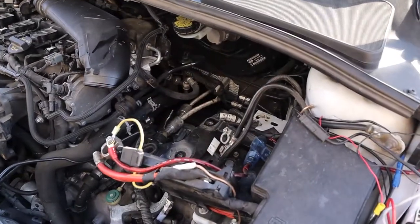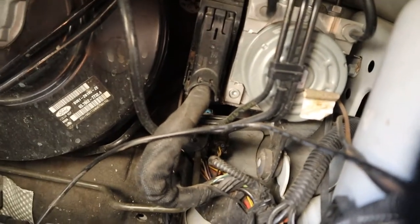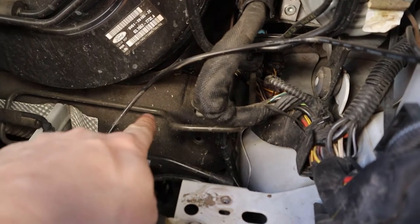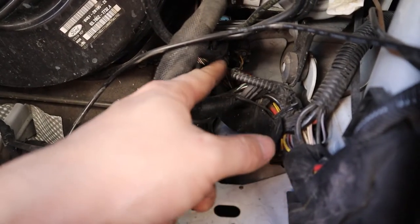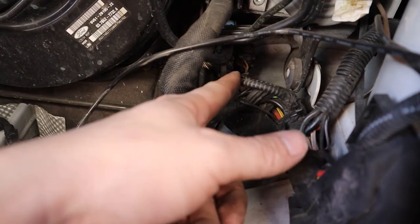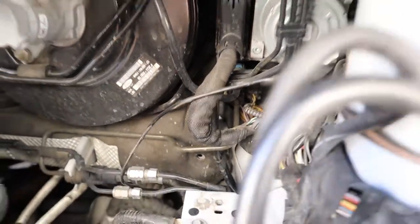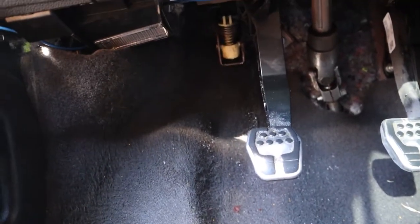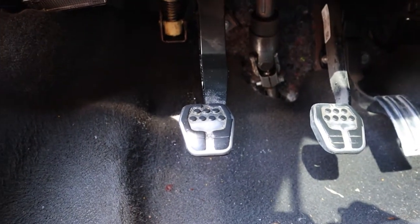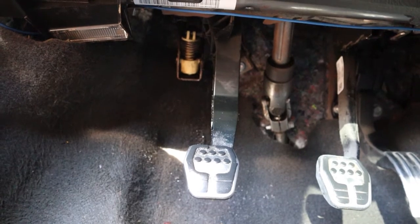We got the battery and the intake box all taken out — you saw that from the montage. Right back here is the clutch line — it comes along here, goes back in there, and then we have this one little wire that connects up to the clutch. That's likely the sensor that allows our cars to turn on and off; they would be hijacking this signal if you were to do a remote start on these cars, FYI. On the engine bay side we also have to take the pedal assembly apart. We've got to set up some light to see up inside the pedal cluster, get to those three bolts, move some wiring around, and then wiggle the pedal loose.